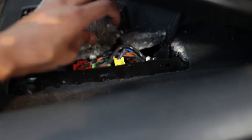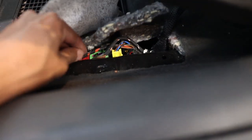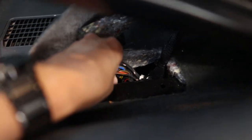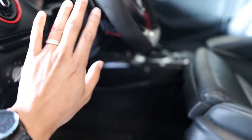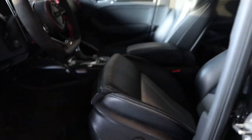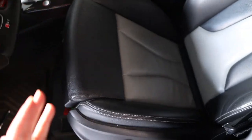Pull up the carpet and lift some of the padding to access the seat harness. It's very simple — just push the tabs to disconnect them. Push the tab and pull straight up; they disconnect very easily. Once everything is unplugged and the harness is disconnected, nothing is holding the seat in. I'd recommend pushing the steering wheel in as far as it goes and tilting it up to give yourself enough space. Then rotate the seat base outward and pull it outside.